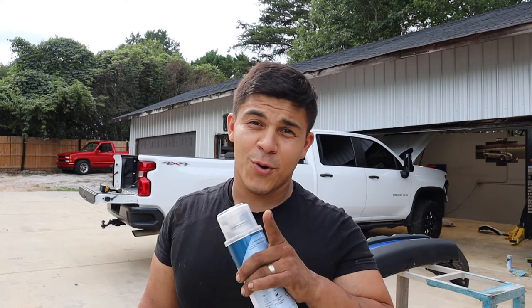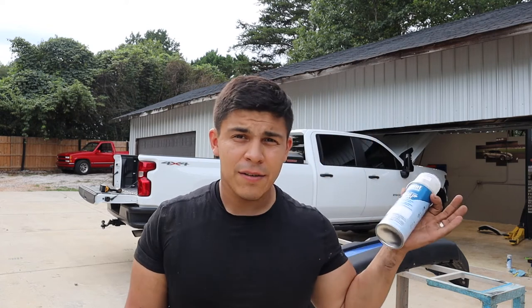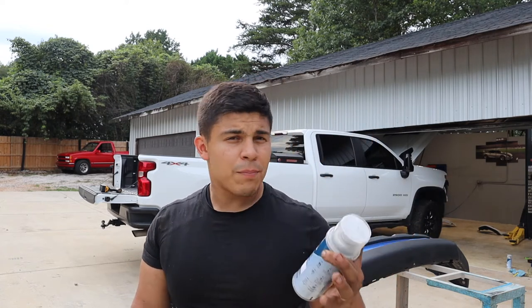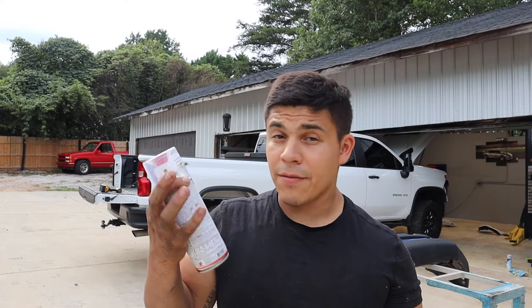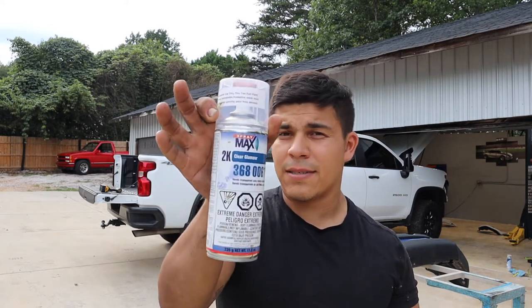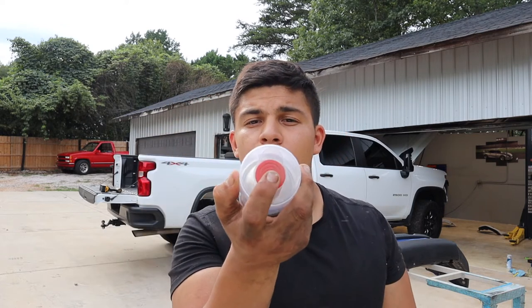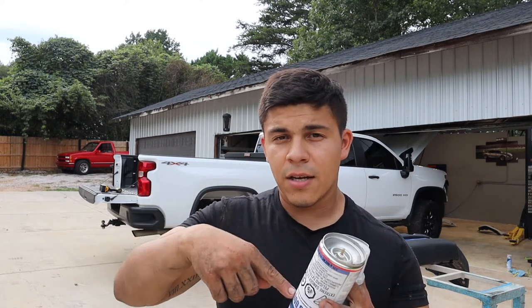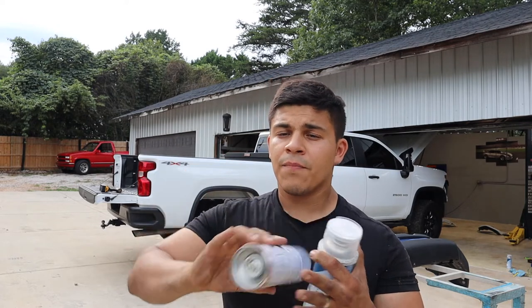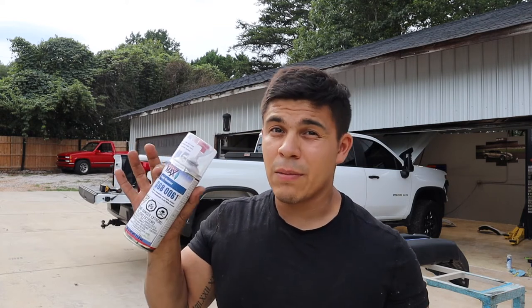The brand I like to use — not sponsored at all — is PaintScratch. A buddy told me about it a while back and I haven't stopped buying from them because they nail it every time. If it's not perfect, most likely your car is too old and sun-faded. They also have clear coat I've used before, but I personally like a two-part clear because that's what gives it that really glossy finish. For that I use 2K SprayMax — the one with the little knob on top. You pull it out, put it in the bottom, and jam it in there, which cracks the inside so the actual clear coat mixes into a true two-part clear. It hardens much better and is more resistant long term.